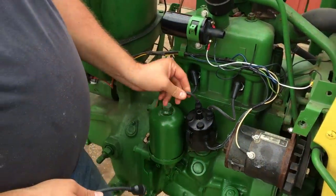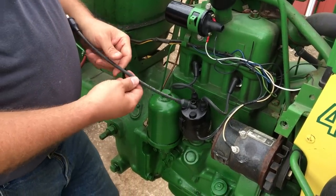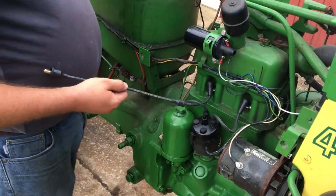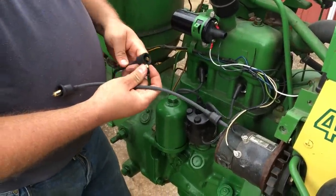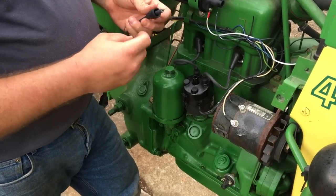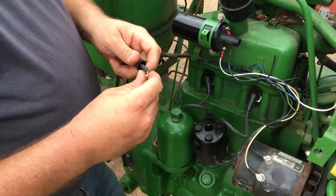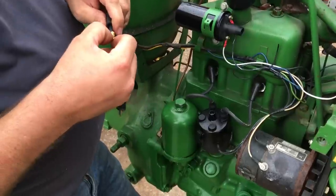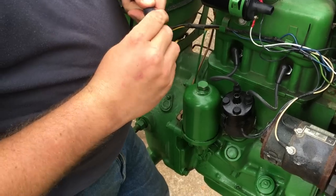Next, cut the spark plug wires to length. Note: you must use silicone core or carbon fiber core spark plug wires with electronic ignition. The originals were copper core — easy to tell because you can see the copper — and copper core wires were correct for the old ignition setup. Since we're going to electronic ignition we want suppression-type wire. Cut to length, and put a little water on the boots so you can slide them over the ends of the cable. The little ends bite into the wire so they don't pull off.